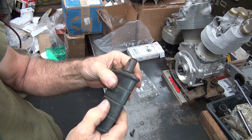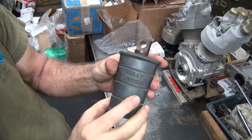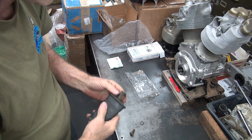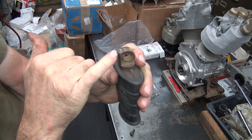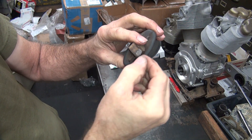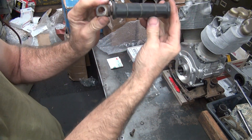This is probably from the 80s, back when Harley would still sell you a pedal. It's been worn quite a bit here where it hits the lever — it comes back too far. All you gotta do is put a bead of weld right in here and get it so it sits straight.